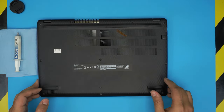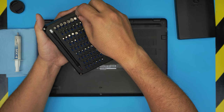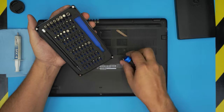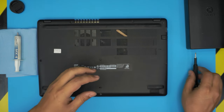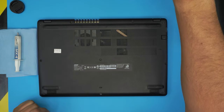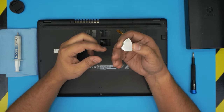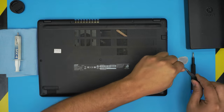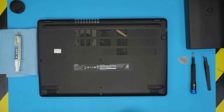The other thing you need is a screwdriver set. I'm going to be using an iFixit screwdriver set, one of my favorite tools, and we're going to be using Phillips number zero. You need an opening tool — if you purchase the pro set you get an opening tool, tweezers, and a few other things. If you don't want the pro set, a metallic guitar pick is really good for opening cases and covers. You also need curved tweezers, which are really handy.